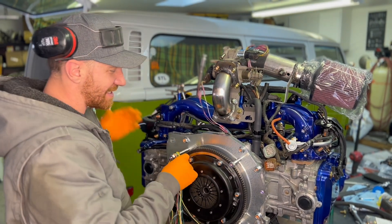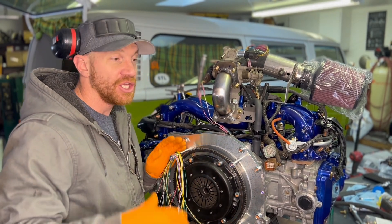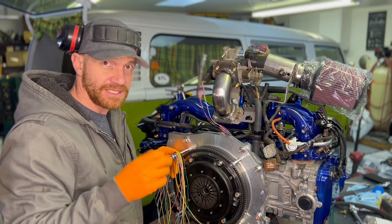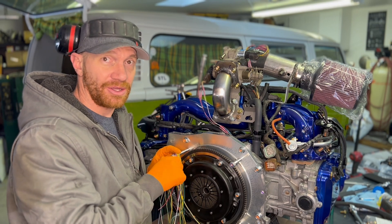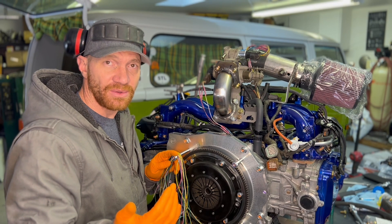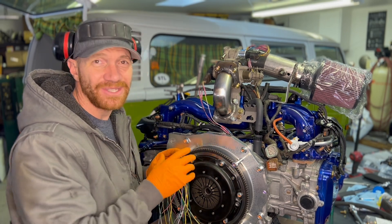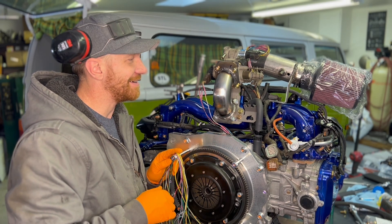PS on this video — I forgot to mention all the wire I have down here. If you have done your wiring harness conversion, you've got boatloads of extra wires. Keep those on hand, because whenever you splice connections and do stuff like this, the ideal scenario is to match not just the same gauge but also the same color. Don't be the person who splices in a blue wire into a red connection — it's just going to confuse everyone later if there's a problem tracing down wires and colors. Find the correct color wire from your pile of Subaru wires, or go to your local auto parts store, get the correct color wire, and do it the right way.